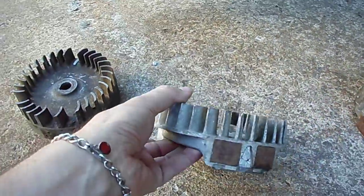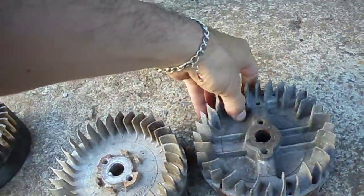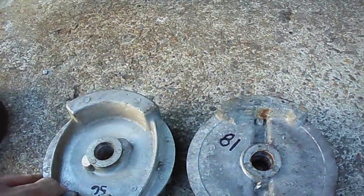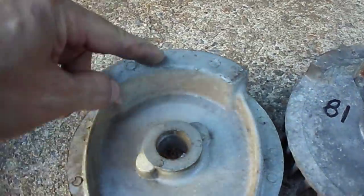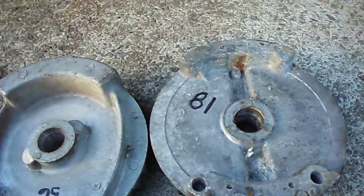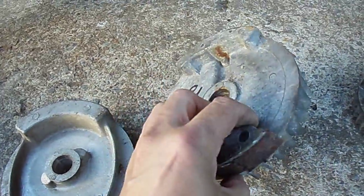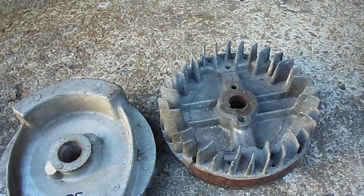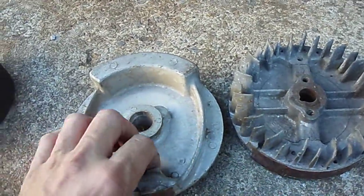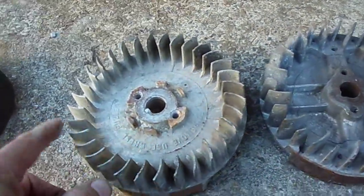Then we go to lawn mowers - say from 1953 up through the early 60s, including my '56. There are variances between these. The 1981 is common to the 70s as well. You can see the differences - the magnet side is bigger on the old one, this has two magnets, this has one, and the counterbalance is bigger on this side. Both of these early ones are very light flywheels. When you start your lawn mower up, you have to have a blade on it. Without one, I've had it suck the cord right out of my hand and pull the handle right off the cord when it retracts into the starter.